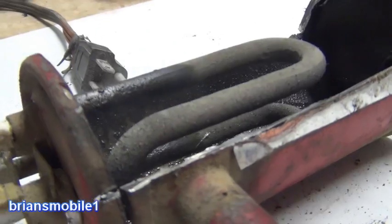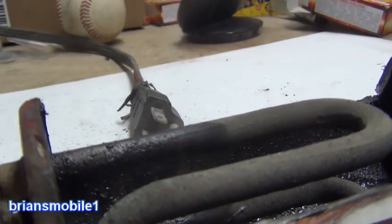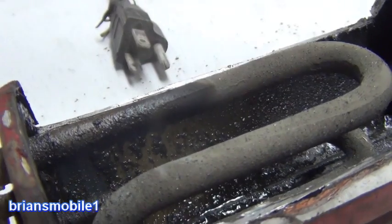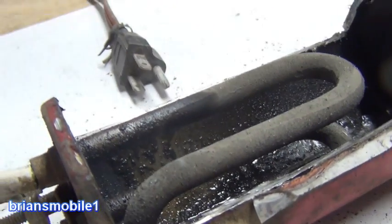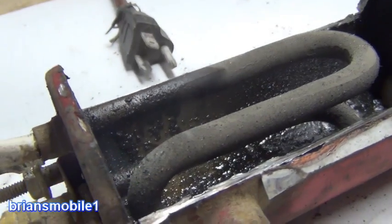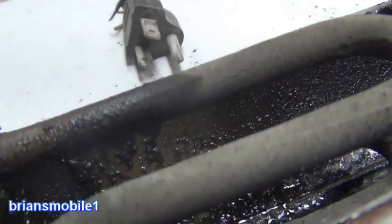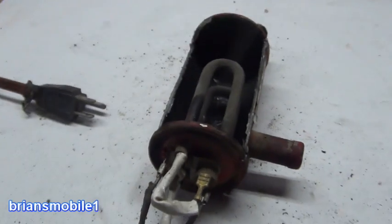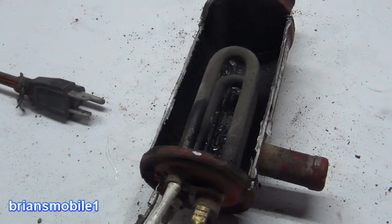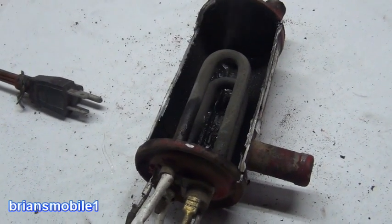You can see that's drying off pretty quick, and we can see that it's actually split — it's cracked. The reason it's not tripping the breaker is because coolant's not getting into it and filling it full of antifreeze. But you can see where it's wet is where it's got a crack in it. So it gets too hot, it doesn't have coolant, it doesn't have circulation — it'll break like anything else does if it gets too hot.